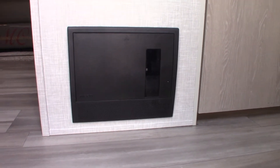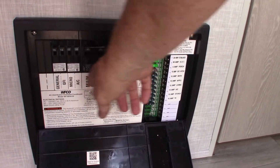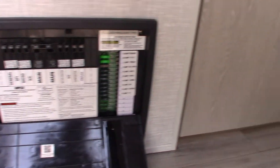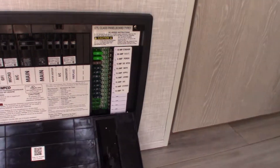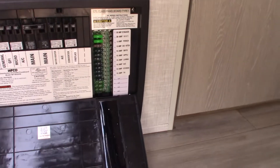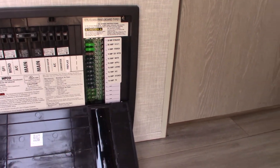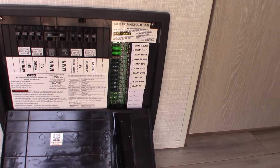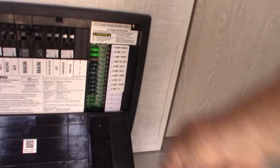As we come in the door, this is your power converter. It converts AC to DC power. You have regular household-type circuit breakers here — all labeled, all 110/120 AC. The power is converted to 12-volt DC over here, so you have 12-volt fuses, all labeled. This is also a battery tender — as long as you're plugged in, it senses how much energy your batteries need and sends it what it needs. If they're topped off, it trickles a couple of amps; if low, it'll send 15 or 20 amps. If any fuses blow, they'll light up and you can see it through this tinted plastic.